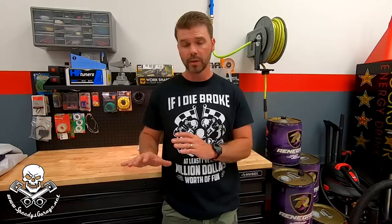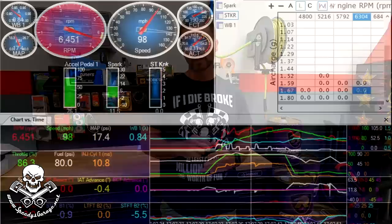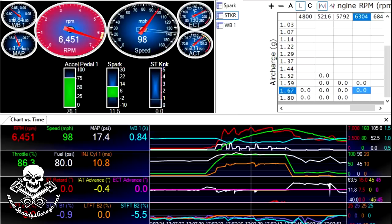So now let's take a look at some of the data logs I was running. Anytime I make a pass at the track, I run a data log just so I have it — and this is exactly why. I can go back and take a look at all kinds of stuff. If something goes wrong, I can look at that and try to find out why. Here's a shot of a data log run two weeks before the engine failure. It was on the same exact fuel — Shell 93 — from the same gas station. Same everything, and you can see everything looks pretty normal.